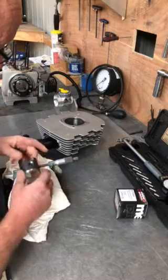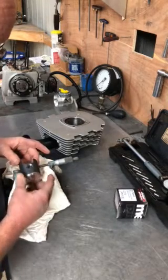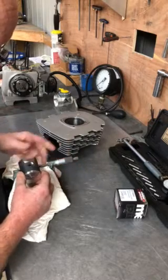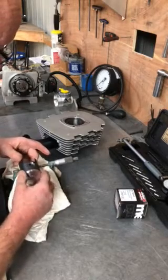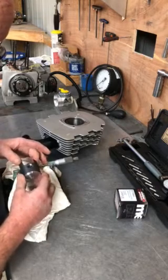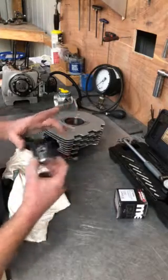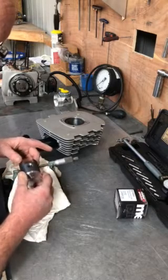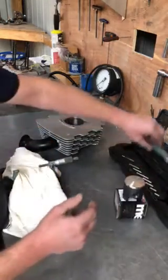If I were to let that go it would just hold its own weight — it's probably a little bit tight so I can back that off a little bit. I need to get an accurate sizing. The biggest part of the piston is measured across here, and I confirm that by just rolling it around to get the right size. Now that we've established that's the biggest part of the piston, I'll put that down.